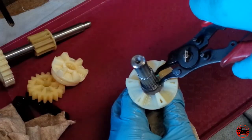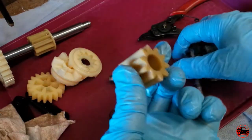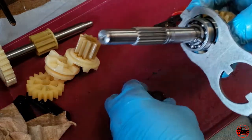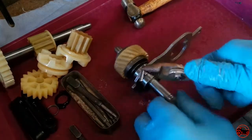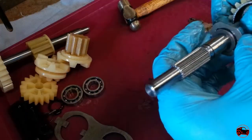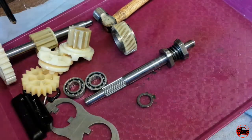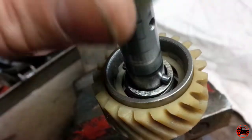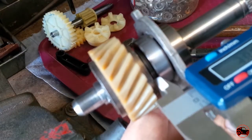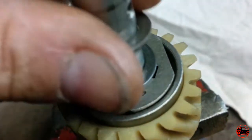To remove the ball bearings I had to open and slide out the locking C-clip. Here you can see the cap that maintains the retaining pin in place on the long side of the shaft. Once the locking pin was removed I inspected the remaining parts. At this moment I did not see anything suspicious about the ball bearings and the small clutch. If you look on the right side of the shaft you can see the small conical clutch system. It was only when I checked the ball bearings in detail that I noticed there was a little slack with the balls. I did not take any chance and I ordered two new ones from GBS.